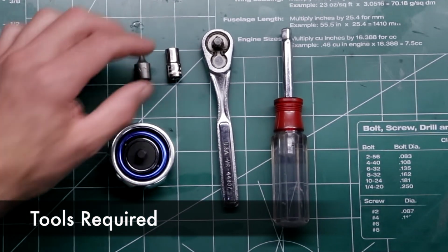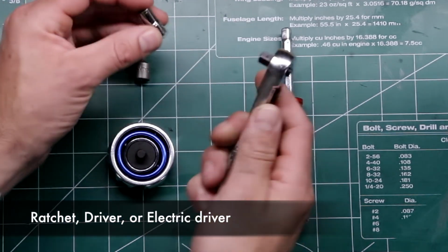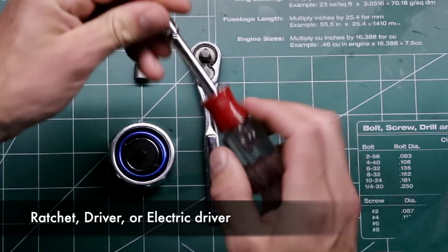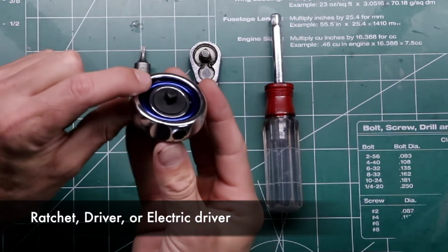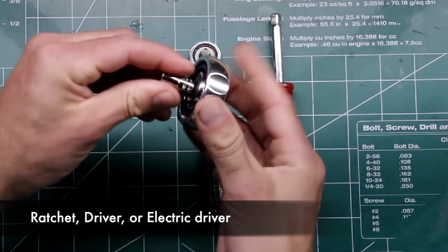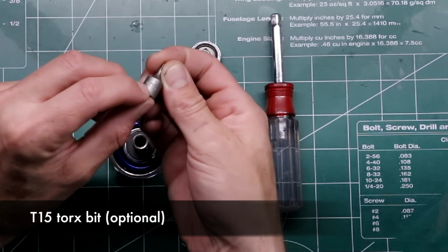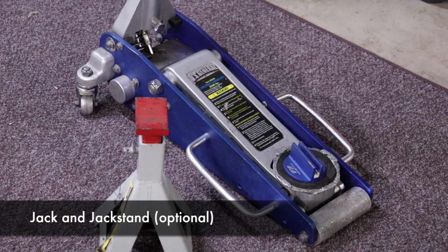For this installation, you really only need the following tools. You need a 7mm socket and some way to drive it. You may choose to use a ratchet, which is low enough and small enough to get under your bumper, or this driver. You could, of course, use an electric driver, which will make things go really fast, but if your car's lowered, it may be tight to get under there. I really like this hand ratchet. It has a gimbal so it can work its way into really tight spaces. You can pick these up on Amazon, a link in the description below. If you plan to remove your tire deflectors, which isn't required, you'll also need a T15 Torx bit. Of course, if you want it easier to reach, use a jack and jack stand.